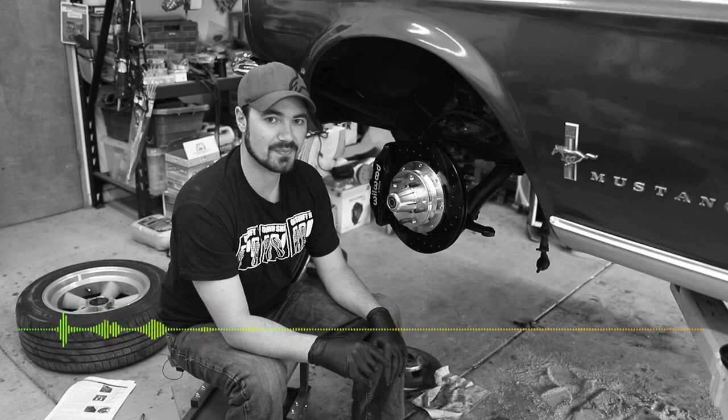He also wanted to point out that while they tried to make these as well fitted as possible, there may be customizations that have to happen car to car, and that these won't ever be a perfect plug-and-play solution. He also acknowledged that there are some manufacturing issues they've encountered, especially with the threading and the thickness of the backing plate, and that the solution I was using of putting a nut on the backside is exactly how he addressed it in his installations. He simply recommended welding a nut in there so that it was more permanent.